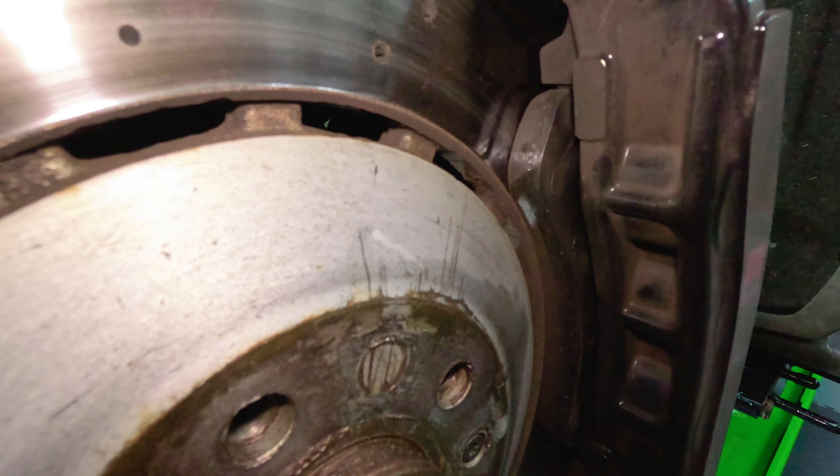These bumpers are quite heavy. Make sure you undo that condensation drain pipe from the inner wheel arch lining — otherwise when you pull this out you might snag it. There's one very fine, expensive RS6 headlight. To remove the headlight you need to take out the screw in the middle, one at the far back in the wheel arch, a third one near the front on the nearside, and finally one just underneath the headlight in the wheel arch.